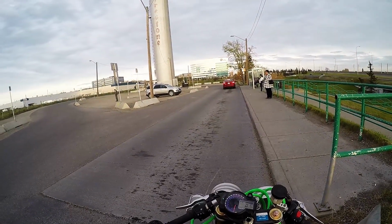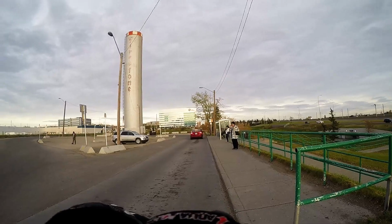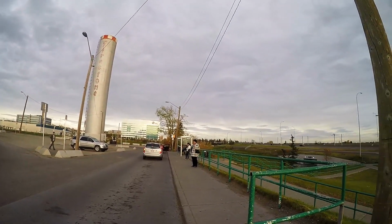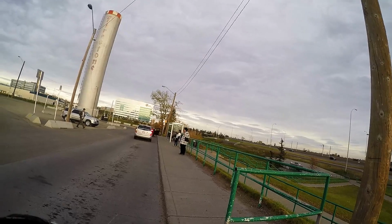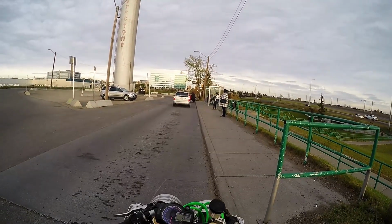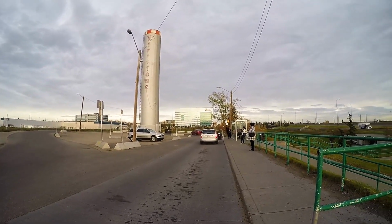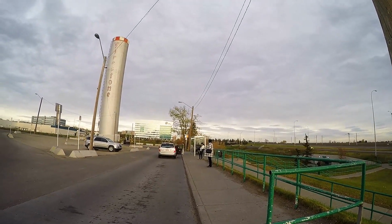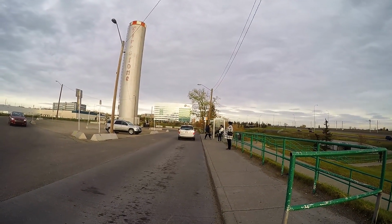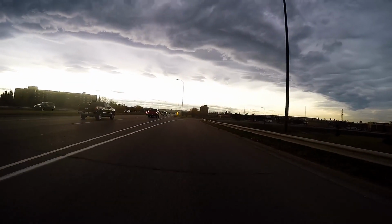If you have a slipper clutch, throttle blipping is not necessary, because what happens with the slipper clutch is it detects back pressure from the tire and slips. So that moment when my tire all of a sudden has to speed up to catch up to the new gear, it would detect that sudden speed up of my tire and slip the clutch a bit, and then it wouldn't cause any loss of traction. But my understanding is you're still hard on your slipper clutch. If you hit it too hard, it's still a mechanical device that'll wear out. So you're probably better off, even if you have a slipper clutch, getting comfortable throttle blipping. And hopefully I'll just put a clip of a proper throttle blip in here.